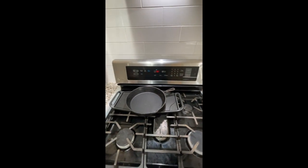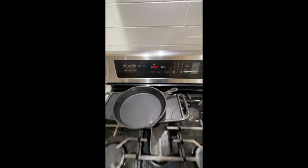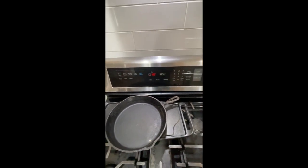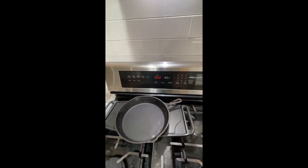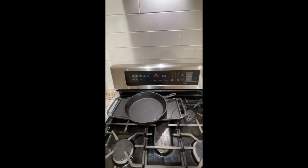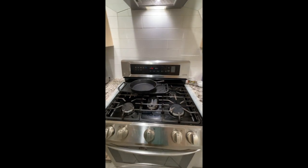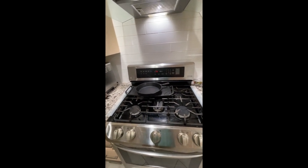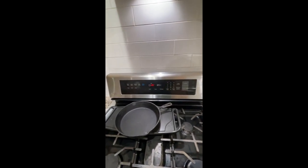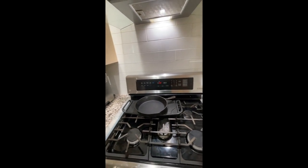That should work, but this oven stops heating at about 125 degrees, so you might want to leave broil on until it gets to around 200 or higher temperature, and then select bake. It should work for a little bit, but we're not sure what's causing the F9 issue. It could be a bad board, it could be a bad igniter — there are several things it could be. But this is just a temporary workaround: go to broil, then set your bake temperature after you turn off broil.